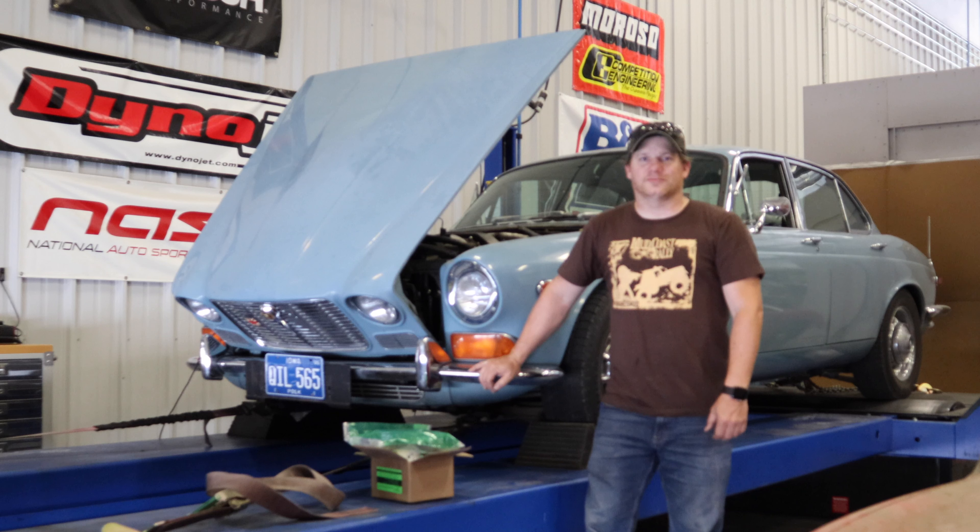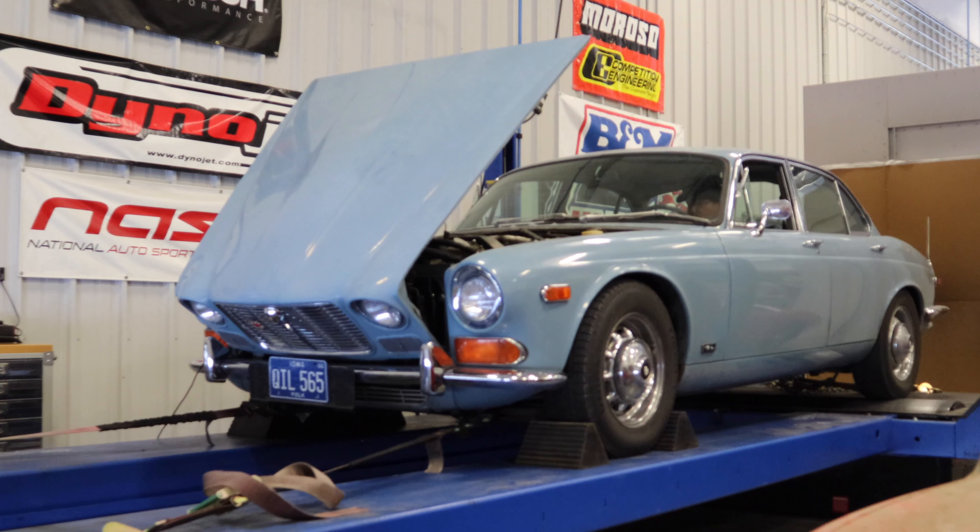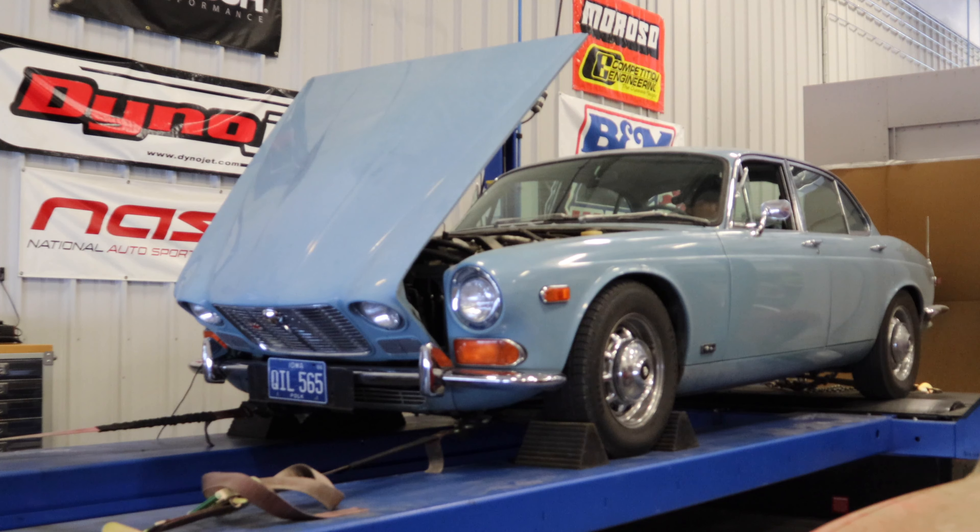Before I install any of this, I'm going to run it again and get a new baseline. We'll also be able to tell since I've been driving this car if anything has improved just from having some miles put on it. Here's the graph from our new baseline — the car did about 40 horsepower. Just like before, it started breaking up in RPM, so the car definitely didn't get any better from the miles. If the problem is an ignition problem, it wouldn't have gotten any better just from driving it.